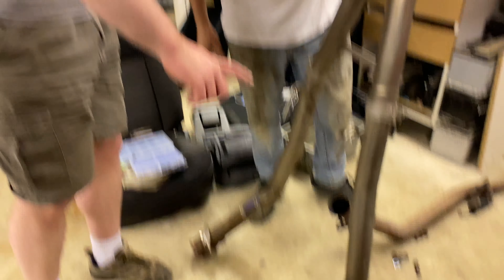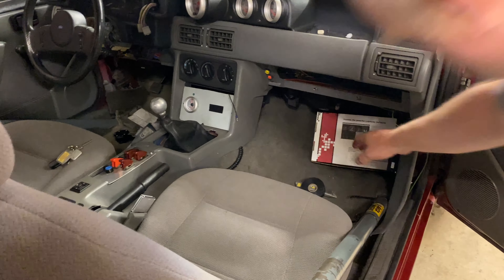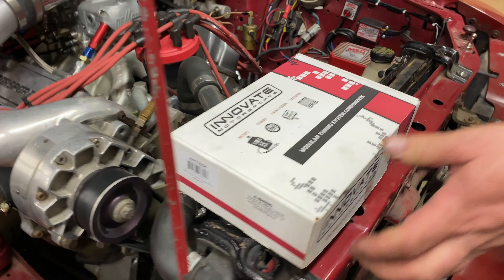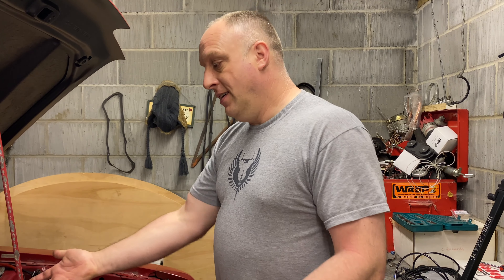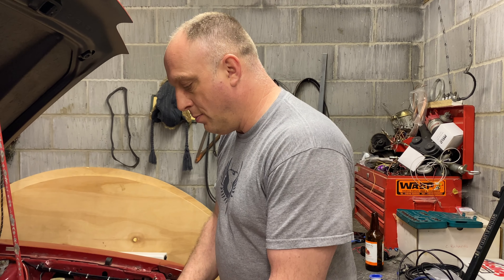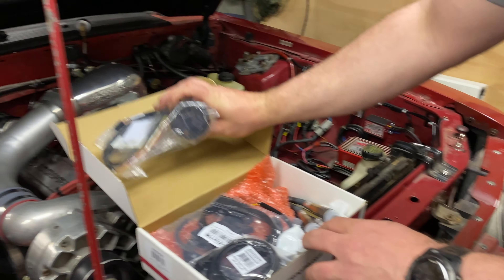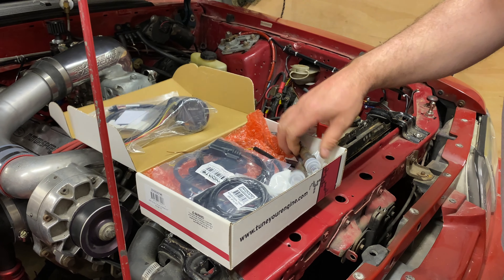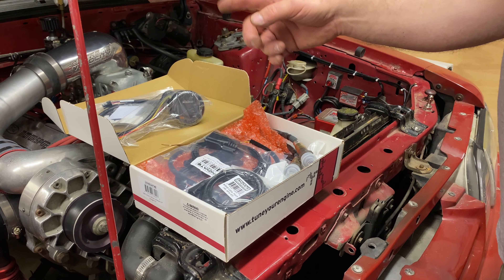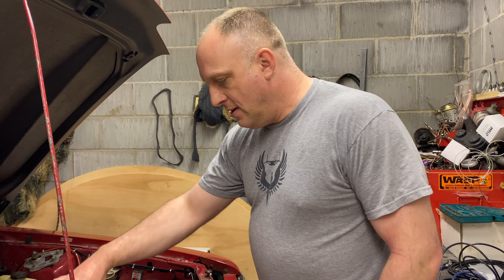Turn around behind you — we got this to fit. Check back here as well. Since Pete had an issue on the dyno where one side was rich and one side was leaner than the other, we figured this was the best thing to monitor that, because this car is all mechanical — there's no computer control or anything that we can play with. Old school, just like him. This is a dual oxygen sensor kit, so we will be able to monitor left and right banks at the same time. I think this data logs as well — it'll log your run, so we can look at it. Because when you're driving down the track, you don't always have time to stare at stuff like this the whole trip down. This is going to be some crucial bit of kit.